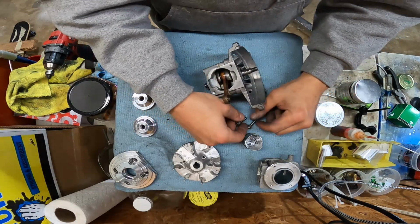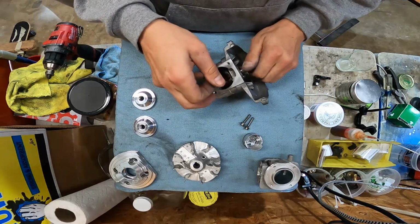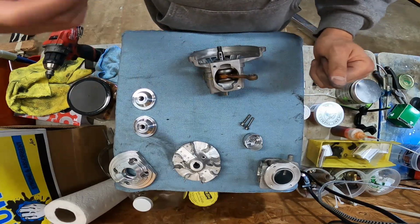And if you have a cylinder that lifts, that means you have a cylinder that can pull air. When you pull air, you run lean, and jet skis are super prone to pre-detonation. Skadoosh, it blew up.